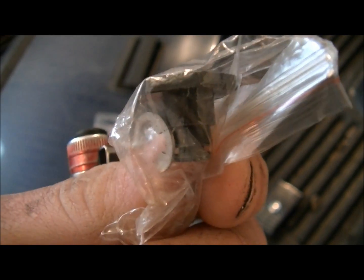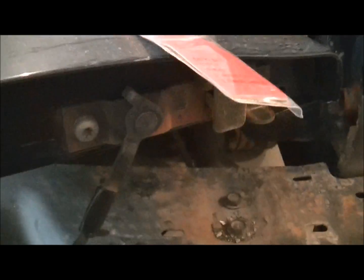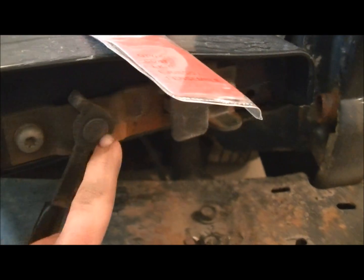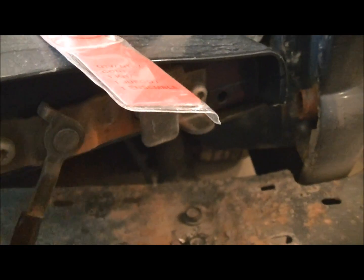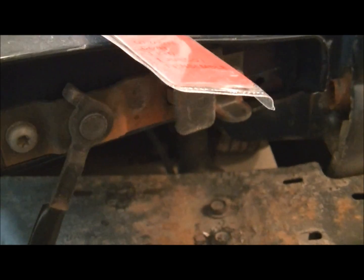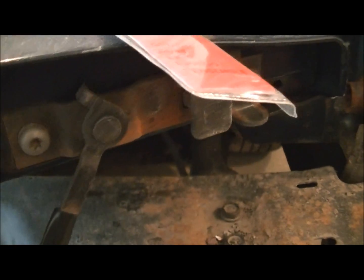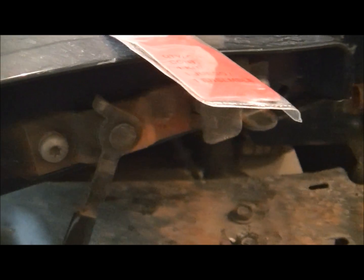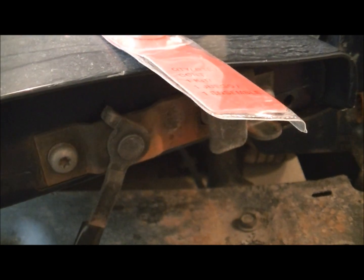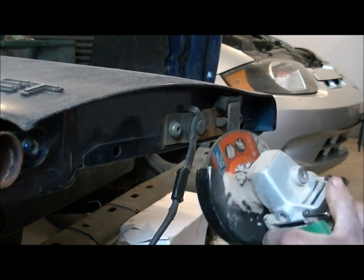It's got a groove there and you put an E-clip on it, but in order to use that you have to get this rivet-type deal out of here and then stick that through with the E-clip. So I'm going to say screw that. What we're going to do is grind this nubbin off, take the old strap off, put a new strap on, and weld a washer — just tack a washer on there a couple times. Alright guys, we're going to start grinding this bad boy off here.